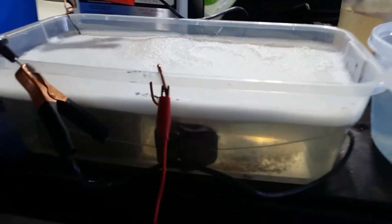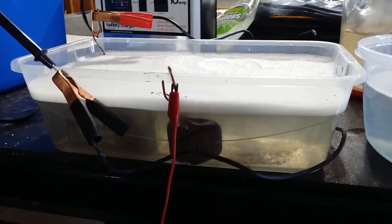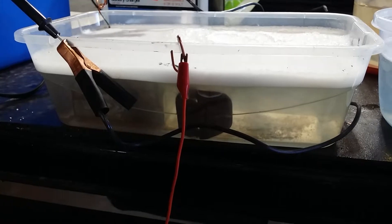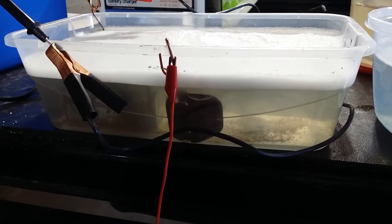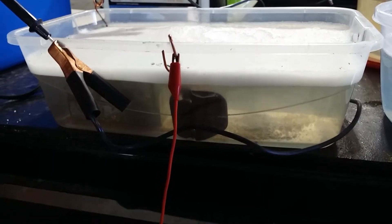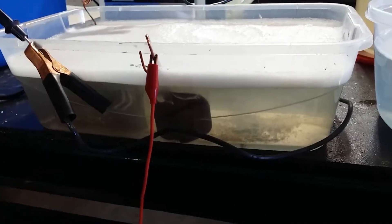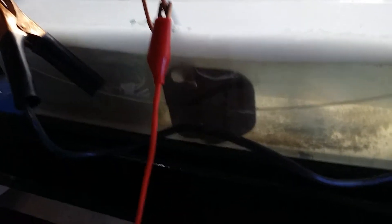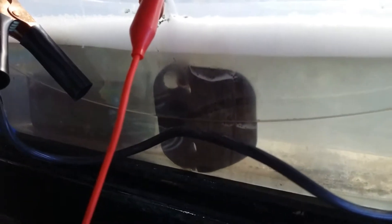It's been in the electrolysis tank for a week and this thing was disgusting — watch one of my previous videos on getting that carburetor apart. I'm still fighting some of it this morning. The aluminum parts were pretty corroded, but the steel stuff was completely rusted. It's in a boat, a marine environment. If I get all the rust off, you don't really paint a choke butterfly — it's got gas in it, it's not gonna last.